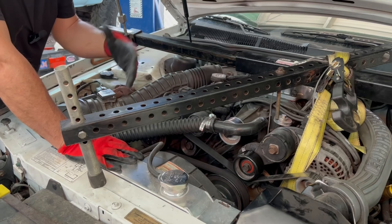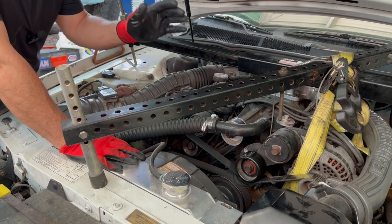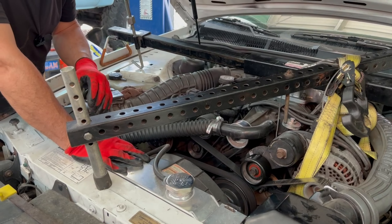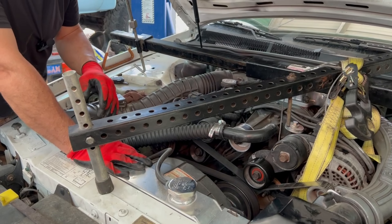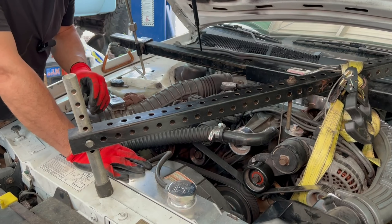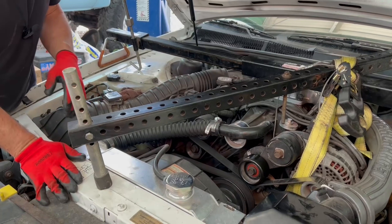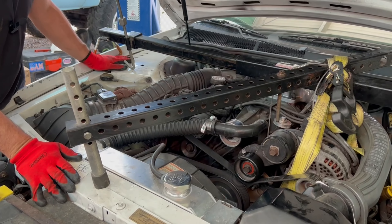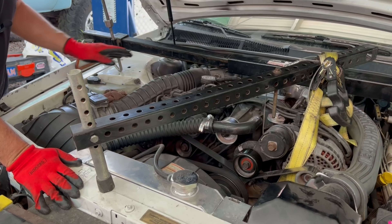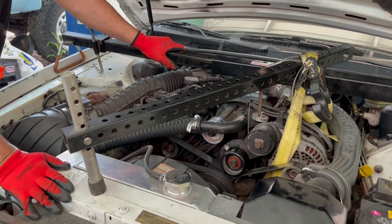You can still take your floor jack once the car is in the air and on jack stands and a piece of wood, and hold up the bottom of the transmission to take some of the load off. That way you distribute it so you don't have to worry too much about anything — whether you're working on the subframe, an oil pan gasket, or whichever thing you want to do under there. Rack and pinion helps sometimes. Quick overview: there's the engine bar. If you have a leg, put it on the core support. You want to get it on the fender edges close to the shock towers — that's where the strength is. Next up, I'm going to drop the subframe.